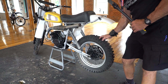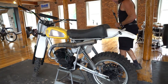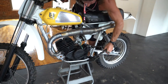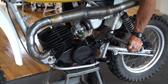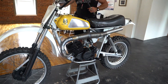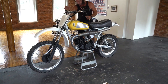The rear wheel is mounted but not tightened up, and there's no chain on it. The swing arm is intact. On this side of the motor, the motor appears to be complete with the kicker, but the engine is actually seized — that's why it's not running. It's been sitting forever; I don't know if it seized while running or from sitting, but it's been in storage for 30 years. The cylinder and cylinder head appear to be in good condition.